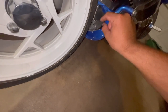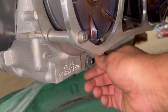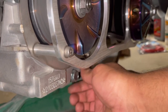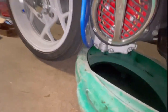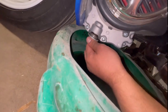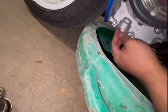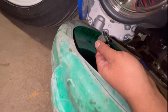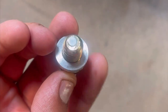Here is our dipstick tube - this is where we're gonna fill our oil, this is where we're gonna add it. Over here it's a 17 millimeter bolt. On this side, unlike cars which have paper oil filters, this has like a mesh screen spring type of thing. There's a little mesh screen - this is our oil filter.